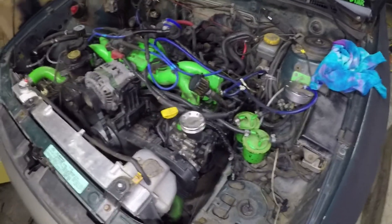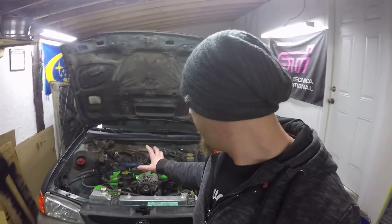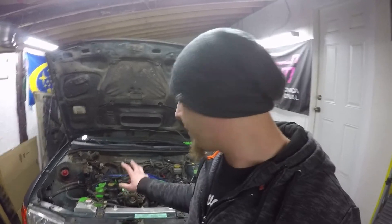We'll finish with the alarm going off in the car — it just keeps doing that; I had to snap the wire off the siren. But at least now I know I have a really good solid running engine, and the compression numbers are awesome. It's just got a couple little leaks that I'd like to take care of. Realistically the engine has to come out for a good inspection of the clutch. I have a good idea I'm going to have to put a new disk in it — I may actually go with a six-puck this time. Just a couple little gaskets and other small parts and we'll be ready to reuse it.